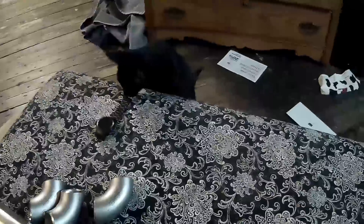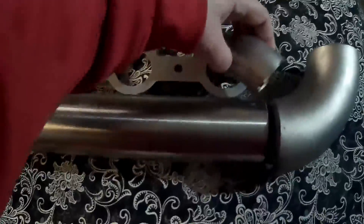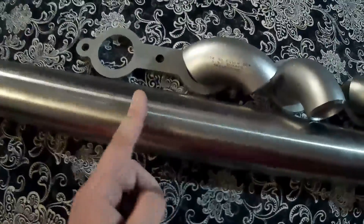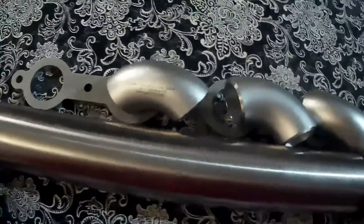My cat Brazil's gonna get up here and help us — what's up Brazil? So what I'll have is this will go something like that, this will go something like that, this will go like that, this will go like that. And then there will be a 45-degree elbow right here, which got held up in customs in Quebec for some reason. So there will be a 45 down and a v-band, and then I'll put a smaller piece to space the turbo up away from the valve cover, and I'll put my O2 sensor for the driver's side bank right there.